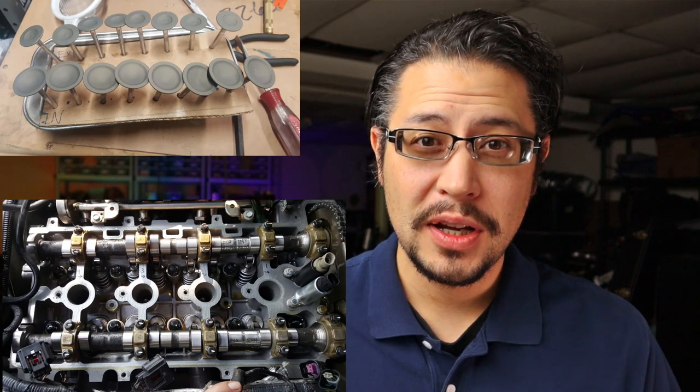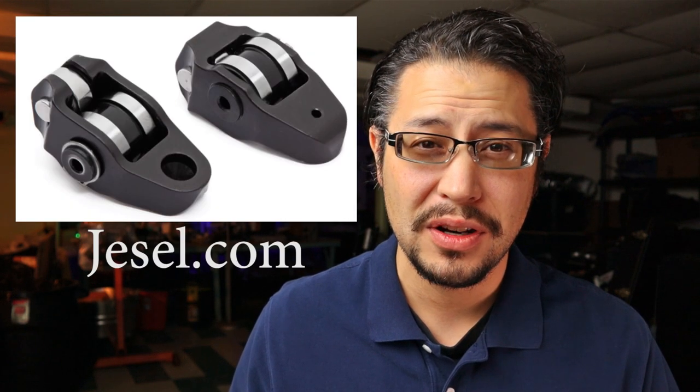The third reason you won't be tuning your four-cylinder NA engine is because you have to upgrade the crap out of the valvetrain extensively, to compensate for the increased masses and inertia from the huge cam and huge intake and exhaust valves. You want as big of valves as you can get, since valves control airflow into the cylinder — so you want gigantic valves with the biggest lift possible. For the camshaft to transfer this increased speed and lift and accelerations, you're going to have to upgrade your roller finger followers and lash adjusters — probably to billet roller finger followers and solid lash adjusters that you shim.